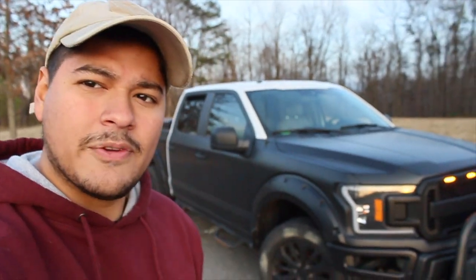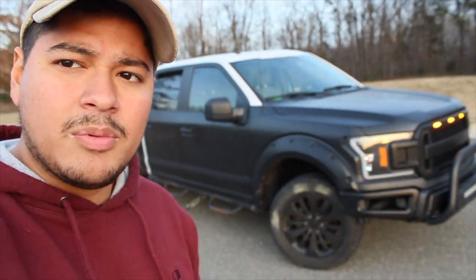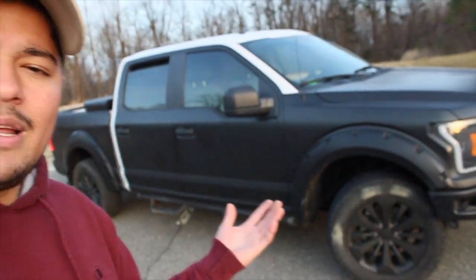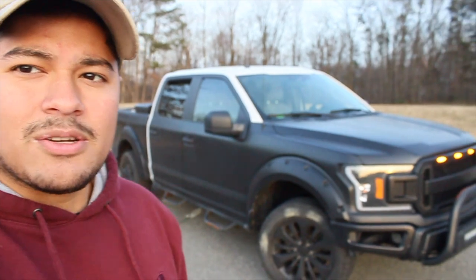That is gonna do it for today's video, guys. PlastiDipping wheels, not that hard of a job. Obviously, prep work goes a long way, so make sure you clean the wheels properly with some isopropyl alcohol. You want to make sure the wheels are off, guys. I know you can probably do it with the wheels still on the vehicle, but you have to watch out for overspray on the tires, overspraying on your calipers or your rotors. Much easier to just take the wheels off and work from there. That is it, folks. PlastiDipping, not that hard of a job. If you have factory wheels and you want to change up the look of your truck or your car, not a bad way to start, guys.